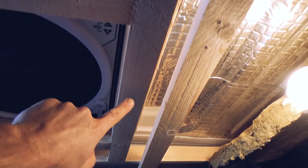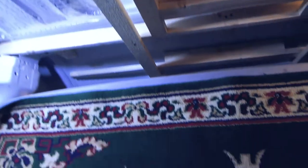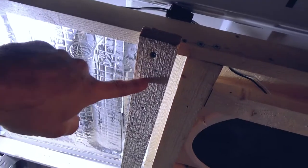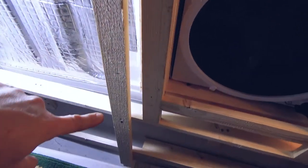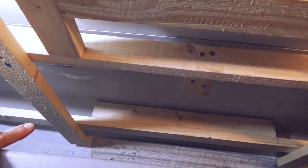I've been insulating the ceiling up to this point — about halfway down the sliding door. I've added some extra timber around the opening to the max van, so when I come to put the ceiling up I'll be able to just route that out and it will look tidy. I won't have to join several pieces together. This is just a piece of guide wood and it continues down into the above-cab storage, because I want to continue the roof all the way to the front of the cab storage.